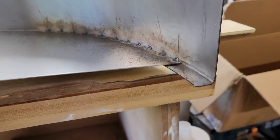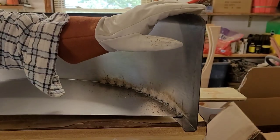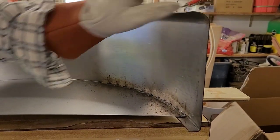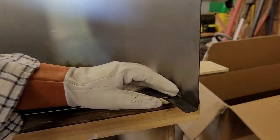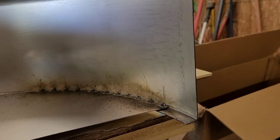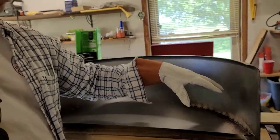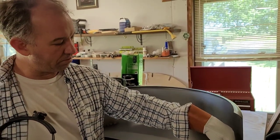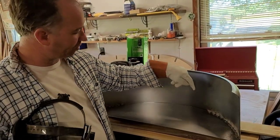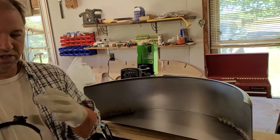Pay a little attention here — you've got a 90-degree curve here but up here it's rounded over. This is the fender that's going to go on the outside of the vehicle, and this is the part that's going to be mounted to the trailer. After I get through tacking this up, we're going to prime it, paint it, drill holes, and put bolts through the shield and through the fender together, then mount it onto the side of our trailer.